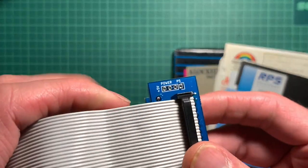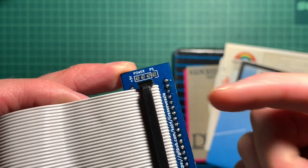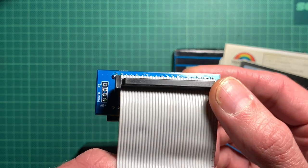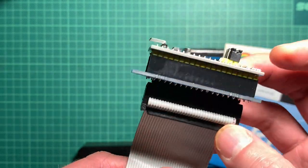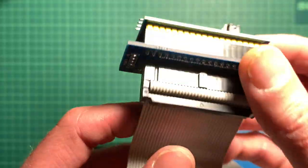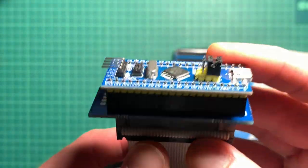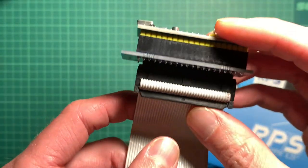My particular version is missing the Molex connector which you would use for powering the floppy drive from the USB port. However, this will only work with certain three and a half inch drives — the older five and a quarter inch drives need a 12 volt supply. The person who soldered this from the DOS Reloaded forum said to just attach a regular PC power supply, which I'm doing because I'm using the drives that are currently in my 486 PC.